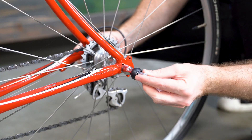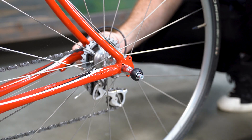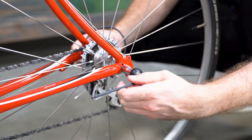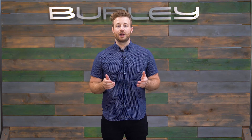If you don't have a torque wrench, use the included 5mm hex key extension tool and tighten the axle finger tight. Then tighten it an additional 3 quarters of a turn. Do not over tighten. Make sure to keep the anti-rotation tab in your bike's dropout while tightening.